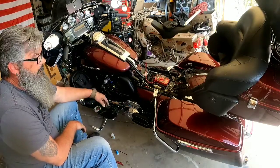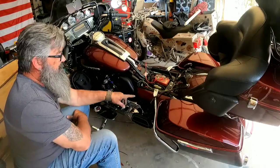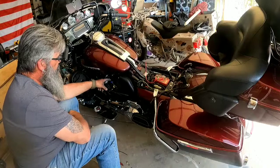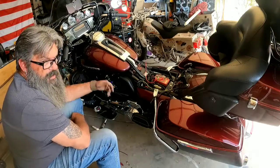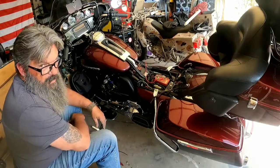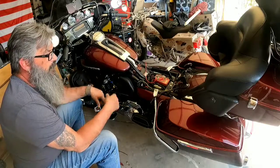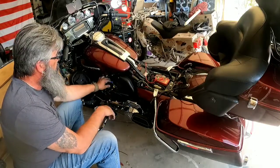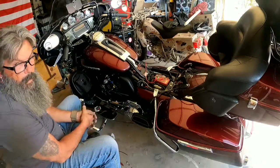You can do the exact same thing that I did by just tapping into a turn signal feed on your hot side, hide your wires, come into your factory wire for your horn, and just put your switch in line. That way you can disconnect it, because if not, every time you hit the turn signal, the horn's going to go off. So now here I go, get ready to go for a ride. I'll walk up, turn off that switch, and now we're back to normal.